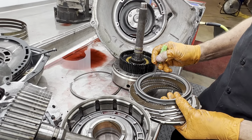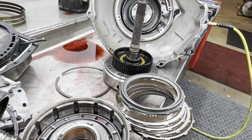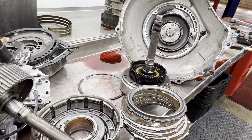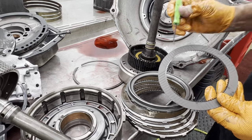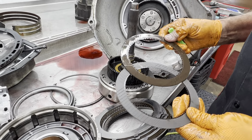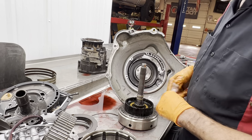The teeth on the clutches are really big compared to a fine clutch. I'll get a clutch and show you real quick what a late model looks like. When they went to the 48RE transmission, they changed the teeth on the clutch. They changed the ring gear here. You can see the teeth on that clutch and the teeth on that clutch, how many more teeth they got on there. So it'll keep it from stripping out. See? You can upgrade it to the later version. All you got to do is change this ring gear right here to the forward planet.